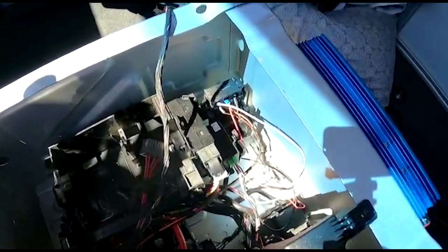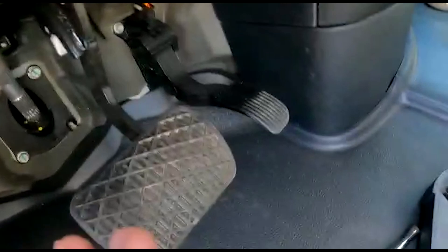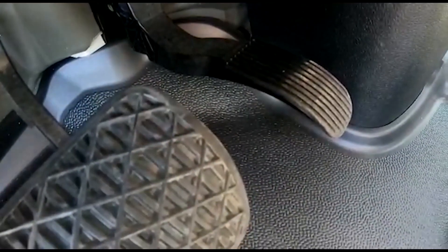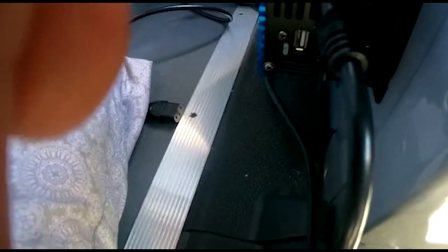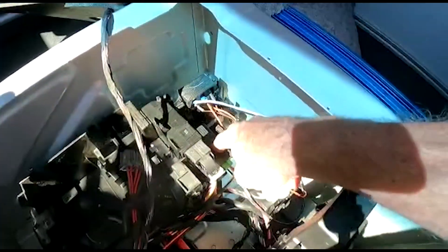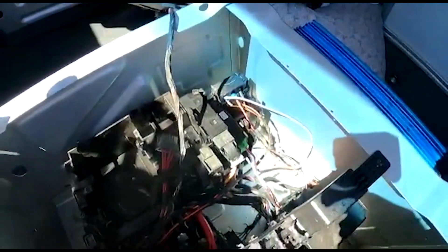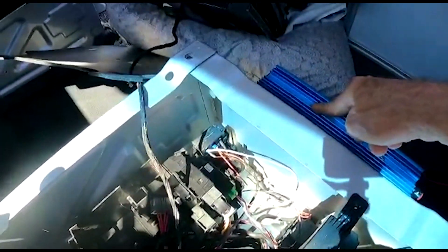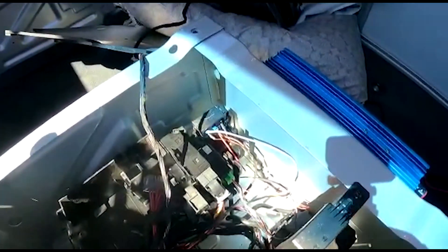That's basically it. Now I'll show you when I actually start the engine. I'm going to put the brake in — and it's on. There's a green light, so it's on. Now watch as I turn it off: I hit the power, it clicked off. So it basically just acts as a switch, nothing fancy. I think you can do this without this module, maybe with a DPST switch. But this was like $40 and it's done. So now we have a DC-to-DC charger — basically a thousand watts, about 80 amps — running off this every time the engine starts in the Sprinter.